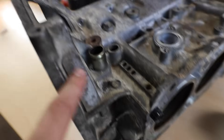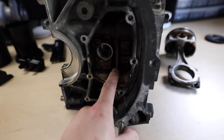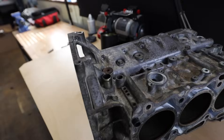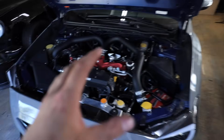What you have are ventilation ports — one on each head for a Subaru, or one ventilation port if you only have one head. Using the EG33 as an example, pressure builds up on the backside of the crankcase and then needs somewhere to go. You'll have a PCV valve port which goes through the access panel in the back of the block, letting all that high pressure escape.